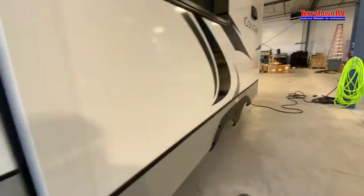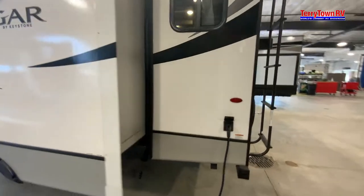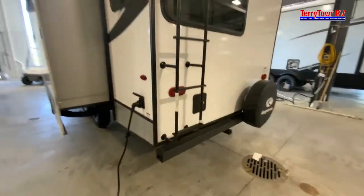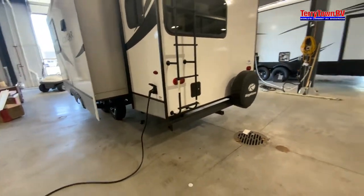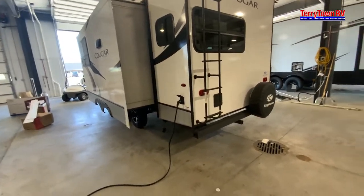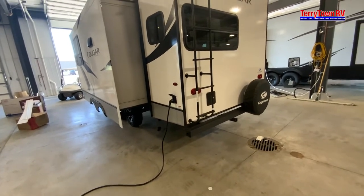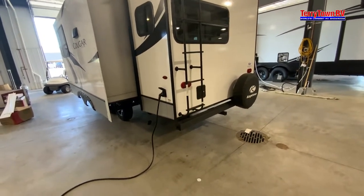You don't want those seals to dry out — that's a major water spot issue. Water is going to be our number one enemy on the trailer. You can hit the side with carnauba wax twice a year; that'll help with de-lamination, decolorization, and help those decals stay pretty. Twice a year you're going to want to go on the roof and treat the roof and awning with a cleaner and conditioner that has a UV blocker in it as well.